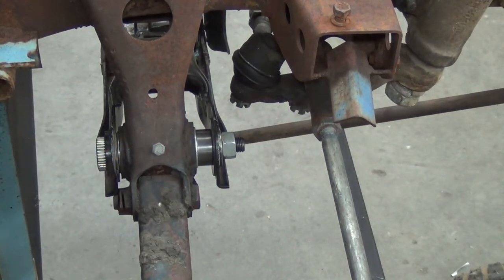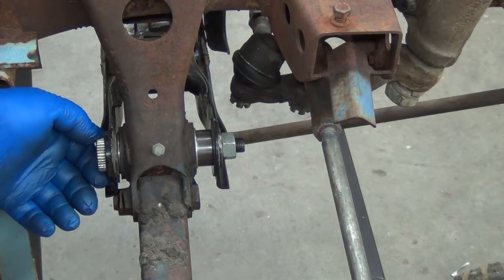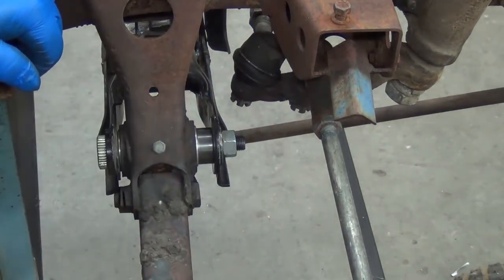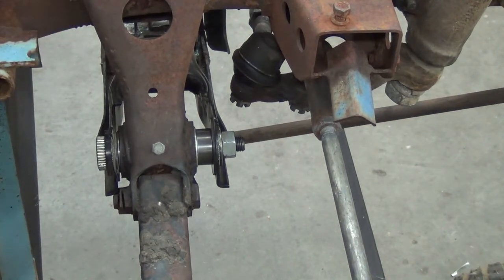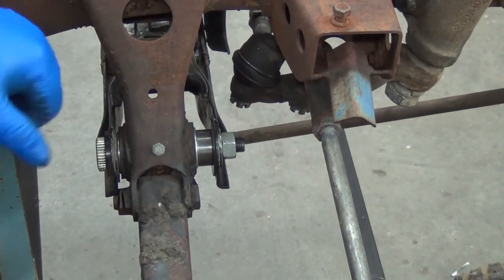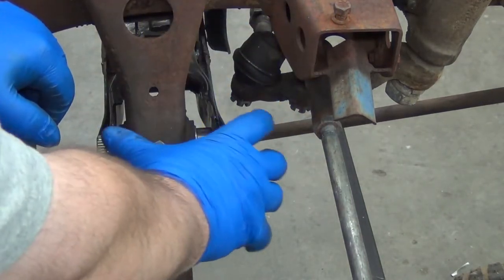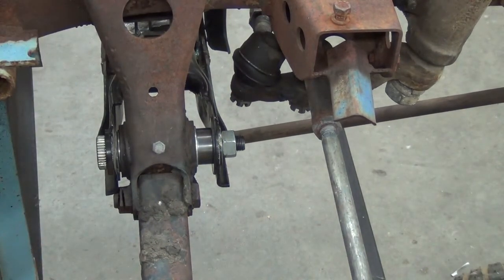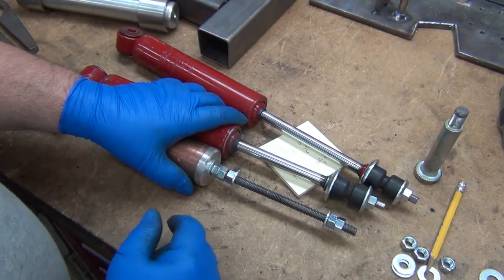I don't have a torsion bar handy to see how much meat's there, but you do it at your own risk. This is how it's getting set up, but that would be an option if it was too much caster. The top's adjustable too. So anyway, that's what I'm playing with right now. So that, because I kept fighting every time I lifted it up and down to check the sway bar clearance and that stuff, the arm would move back and change my angles and everything. I was like, man, it's getting kind of annoying. So fixed.